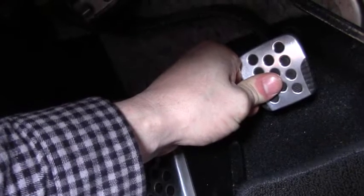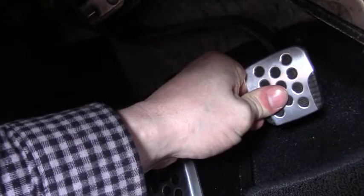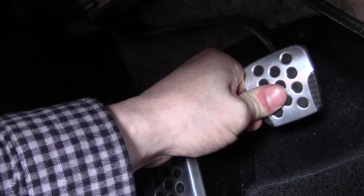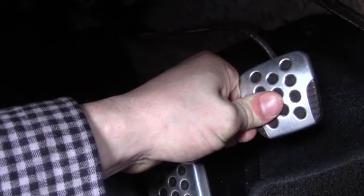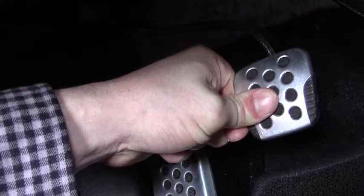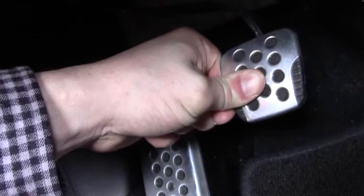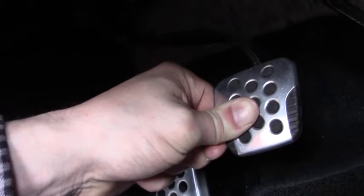All right, the clutch pedal can come out, I'm starting to come out about that much before it even starts to release that throwout bearing. And then it slowly releases, and I'm still going. And somewhere around here is where it actually fully grips, just bam, grips. And then it's actually just right here, right at the end, and then you have just this little dip at the end.